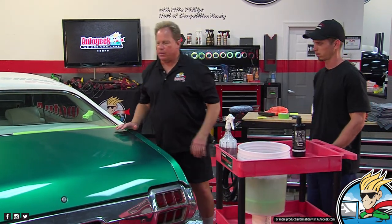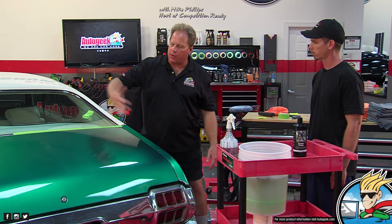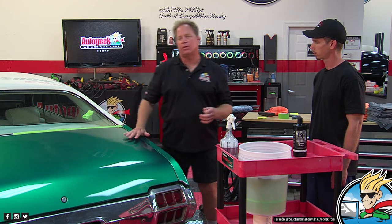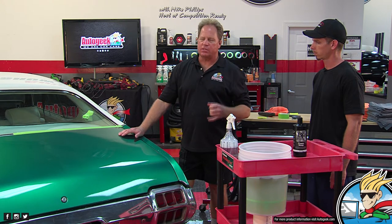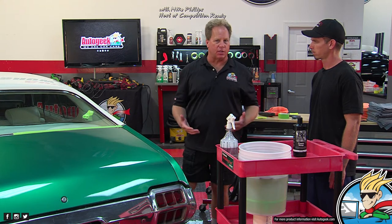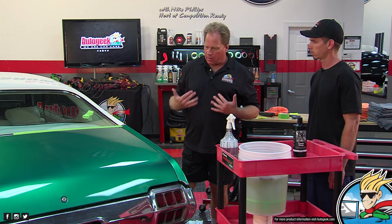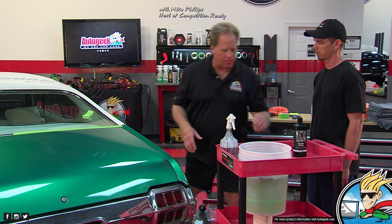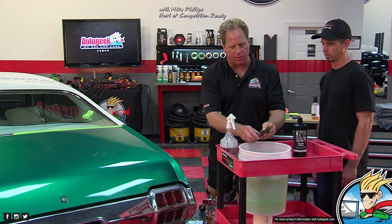Now, the next thing you want to do is figure out which direction you're going to move your hand. For this video, it's going to work better if I just go ahead and sand across. There is no right or wrong. You want to let the panel talk to you. Usually, you don't want to sand in circles or in a crosshatch pattern. There is such a thing called the X pattern for people with a high proficiency level. But for most people, you just want to sand in the same direction and keep it that way. It gets kind of complicated, but I don't want to make this video that complicated. So we're just going to show what works best for the camera angle, not for the car.